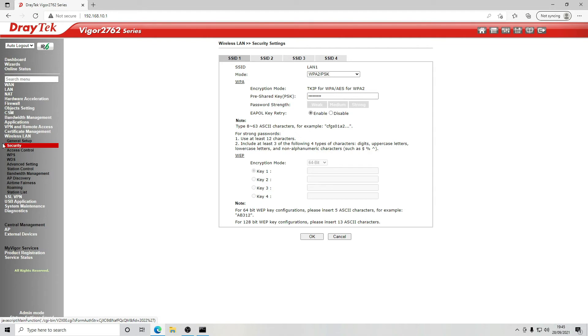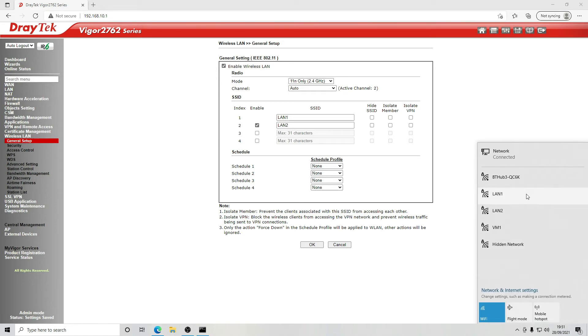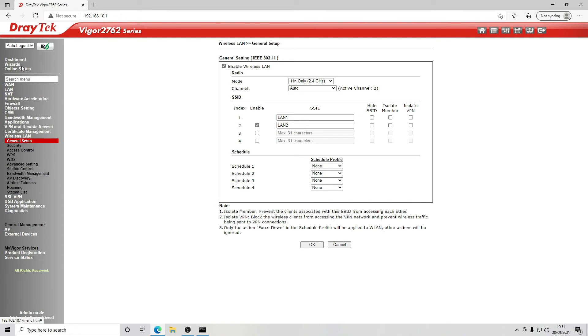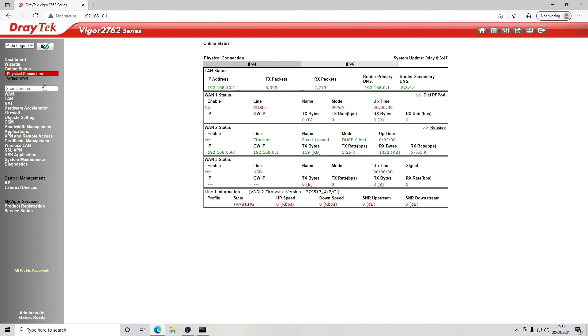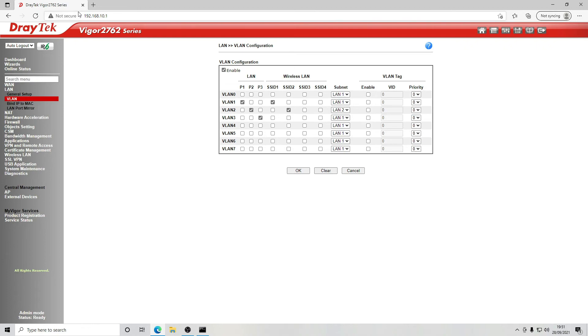If you check your mobile phone or look at available Wi-Fi networks — I was using a 5GHz-only adapter, so I've inserted a Wi-Fi 5 and Wi-Fi 4 adapter supporting both 5GHz and 2.4GHz. You can clearly see our two LAN SSIDs being broadcast. Going back to the router status, we've got WAN 2 connected, LAN connected, VLANs all set up correctly, and both SSIDs connected.